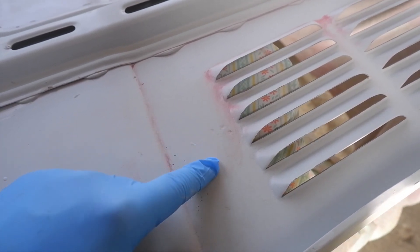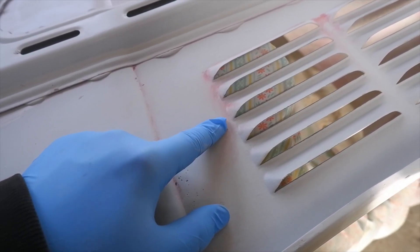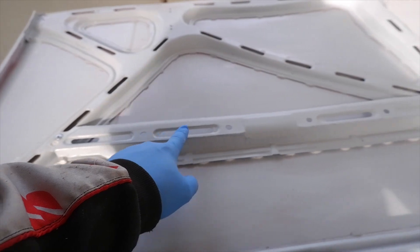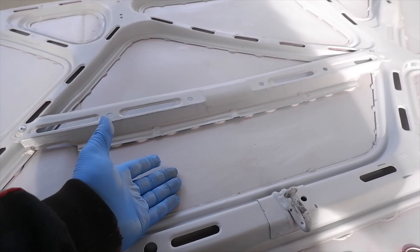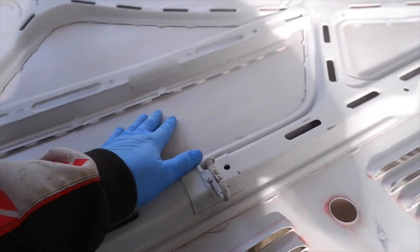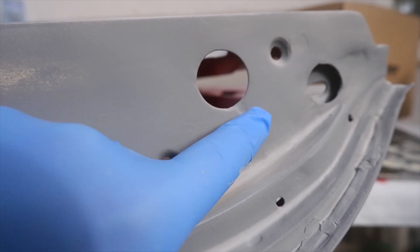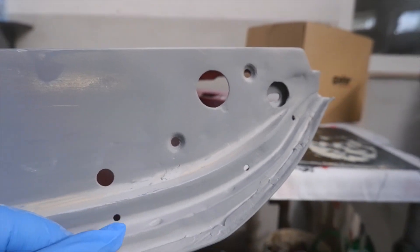We have three more holes here from where a lot of rust was removed, giving us some surface imperfection — this area requires some body filler, which we're going to sort out so it looks nicer. We also added a reinforcement bar in the hood because the hoods are notorious for jumping a little bit, which is bad in the sun due to expansion and movement of the metal — this can cause paint problems. The bar will hold the shape in place. We also found some imperfections and will apply seam sealer to hide the welds.